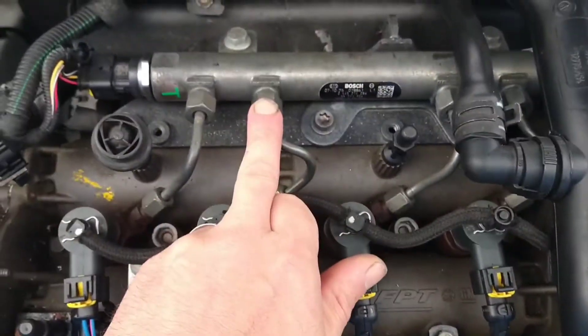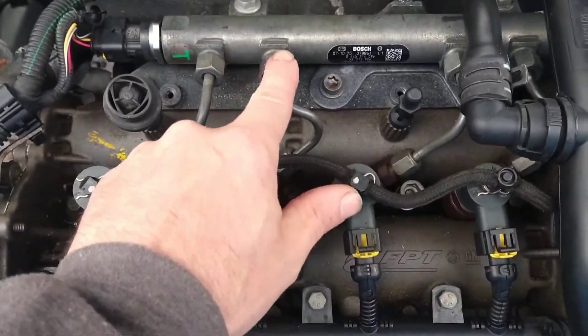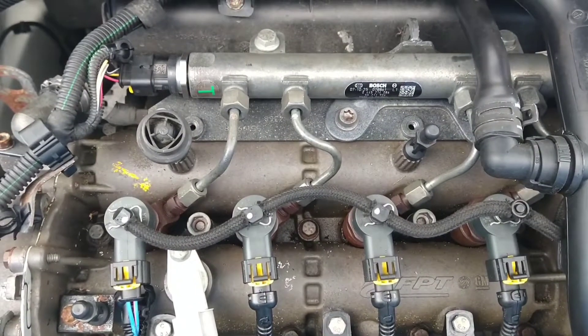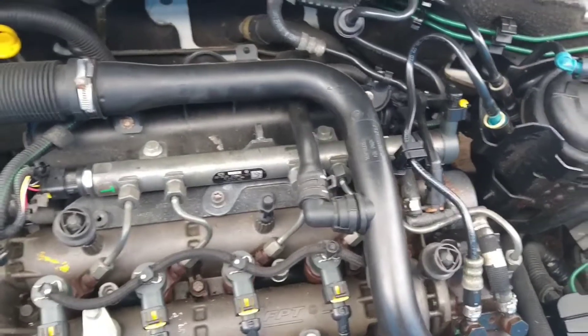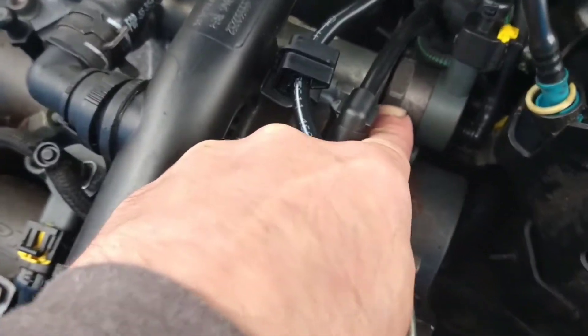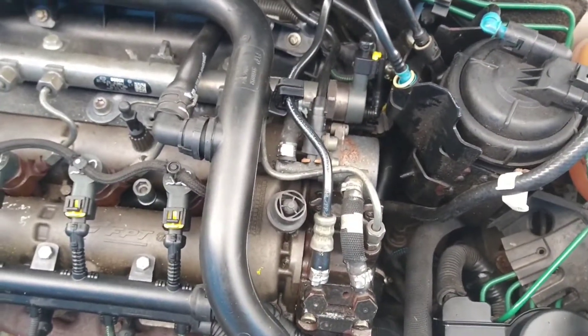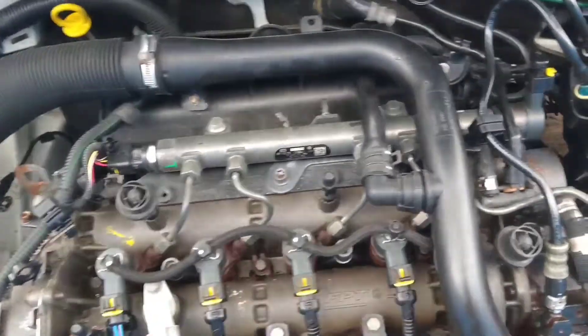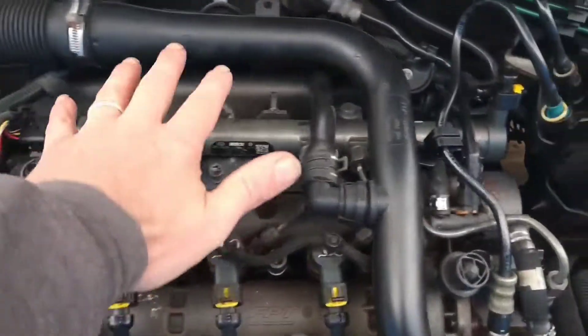I've had just one injector in cars leaking too much for it to build up pressure. I've been able to blank off the injector that's got excessive leak-off at the pipe, and it started but ran on three cylinders — it still starts. So then you know what the problem is. I also had an actuator kit so I could plug that up and stop any return going back to the tank and see if I get a rise in pressure. But I didn't need to do any of those leak-off tests because I had pressure.